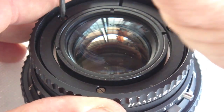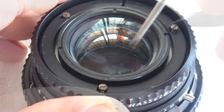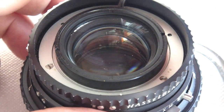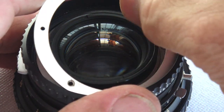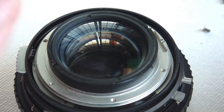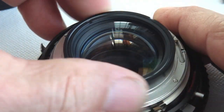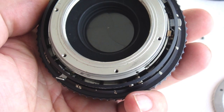Remove the three screws that hold in the next ring. We don't particularly know the name of the ring — it just needs to be removed. Then we'll have another ring that will also have to be removed, held in with three screws. Always use the proper size slotted screwdriver so the screws are not accidentally marred. Be careful not to lose the detent bearing. Lift it free and set it aside. Then lift the shutter speed ring and set it aside. Now we have the aperture ring — set it aside. Go ahead and remove the lens; you might have to use a spanner wrench. The whole group will come out as a unit.